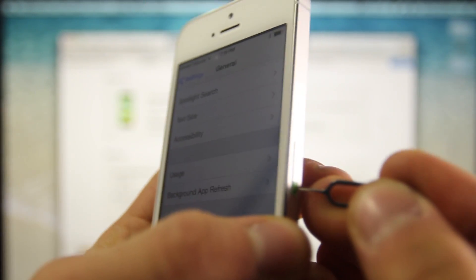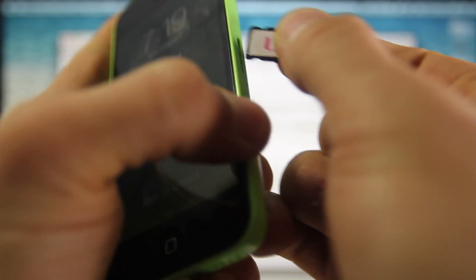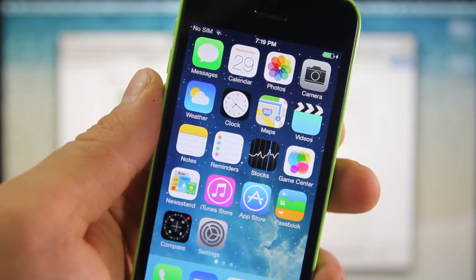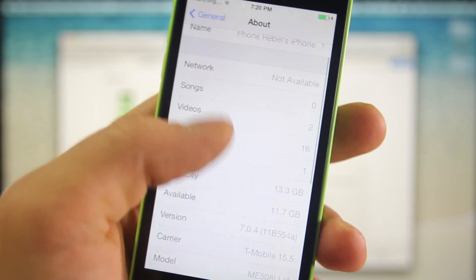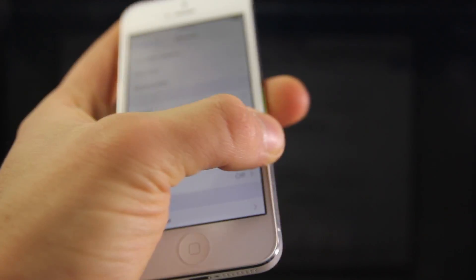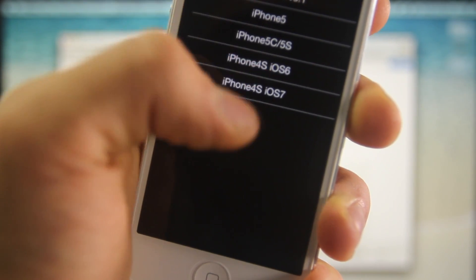But say you want to use the unlock on another phone, or you just used it to activate this iPhone and want to put it back to the other phone — you have to reconfigure it. If you don't reconfigure it, this is what you will get. I'm putting it back into the original phone shown at the beginning of this video. Any moment now we'll be going to the activation menu and it'll say 'This SIM card is not supported.' Basically, when you program a SIM card for a phone, it believes it's the original carrier SIM card. So it's like I'm taking a Sprint SIM card and putting it back into an AT&T phone — I have to reconfigure it on that phone before putting it back into this one.